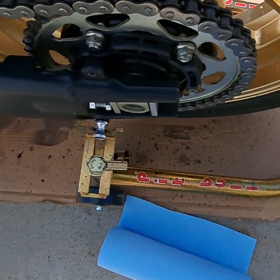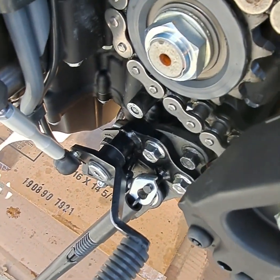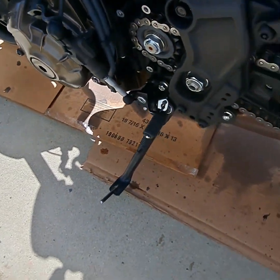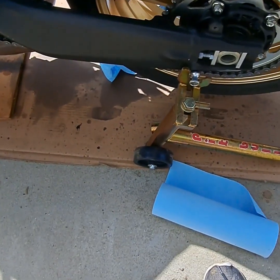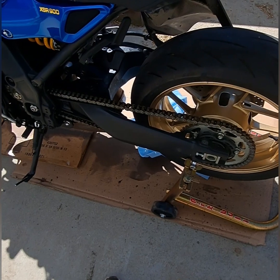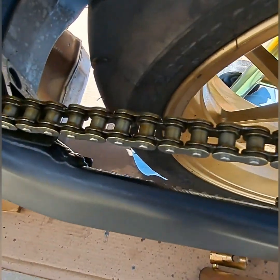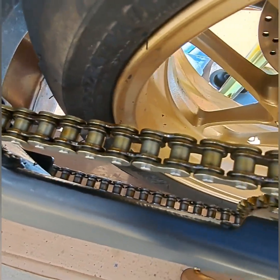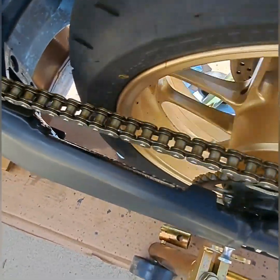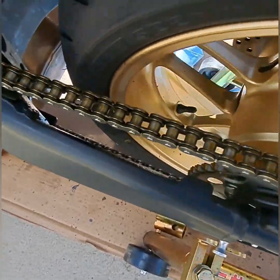Nice and clean. I got to clean my rims now, but the chain is nice and clean. See that front sprocket area — nice and clean. I got the compressed air and blew all the moisture and water off. Now I want to get my chain lube and lube that chain. The chain is clean and lubed — that chain wax leaves a light, very light brown residue on the chain. Rotate it several times to work that oil in; it's going to get tacky and dry in about five minutes or so.